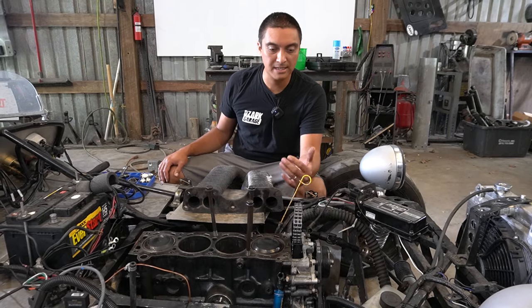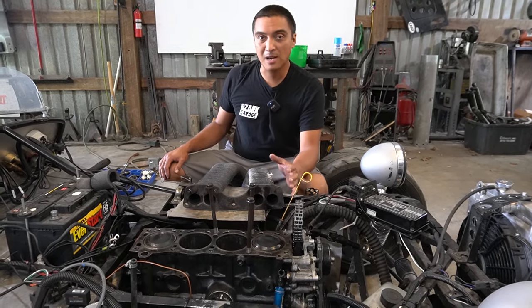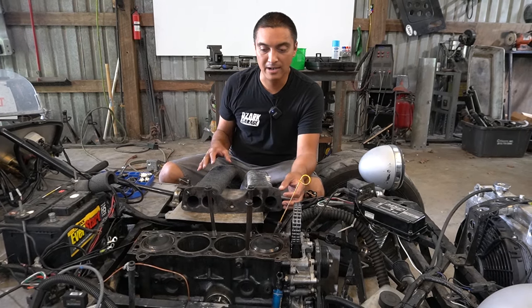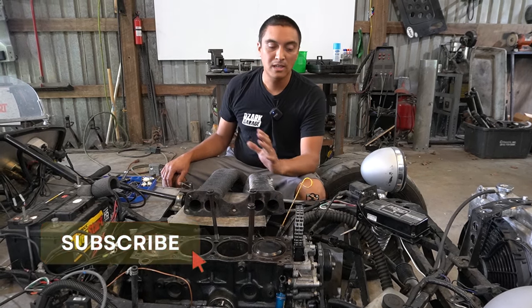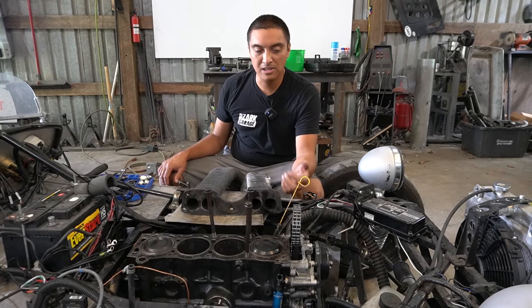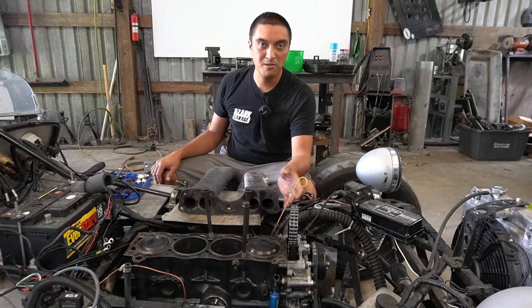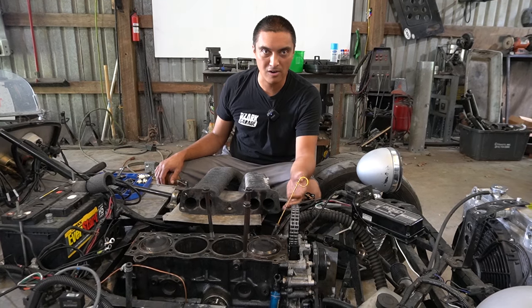I got the streaming portion of the idle just fine, but then I started having what I thought at the time was misfire around 3,000 RPM and higher. I continued to try to do testing with fuel and timing changes, and the only thing that really fixed it was removing a lot of the timing advance. If I removed the timing advance it would run like a dog, but it would not misfire at higher RPM.